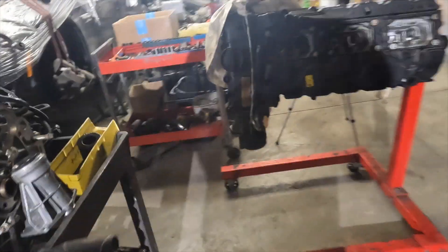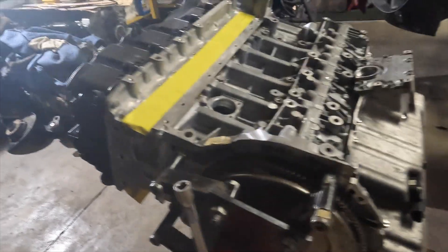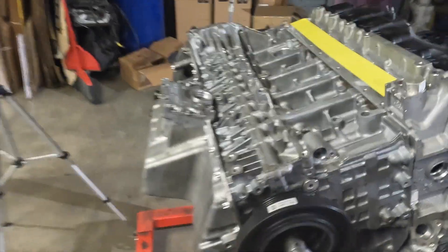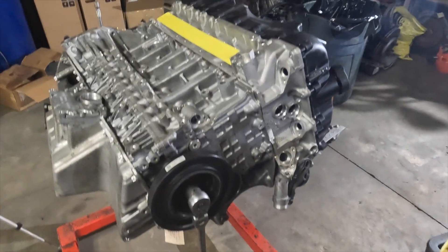So this is going to be a rebuild. We have a freshly rebuilt engine — if you guys have been tracking my builds, this is engine 1227701, which just got finished rebuilding. We're going to transfer everything from the old engine onto this one, and this engine is going into the car. First thing we're going to do is get the wiring harness over, move the alternator over, and then start attaching the pipe in, the vanos valve, and getting all the engine mounts attached and so forth. I'll periodically give you guys an update on where we're at.